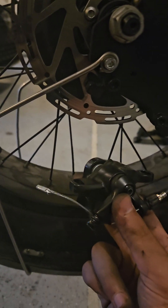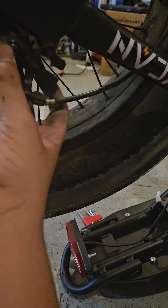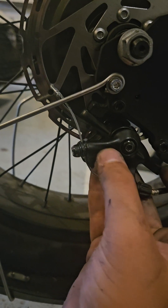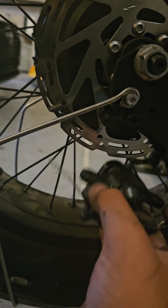What you do is you take off your actual brake caliper. Your bike comes pre-built with the caliper on it, kind of like that. All you do is take this screw off and the screw behind the adjuster, which is right there, and take it off.